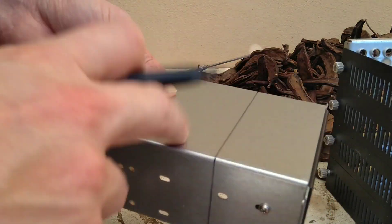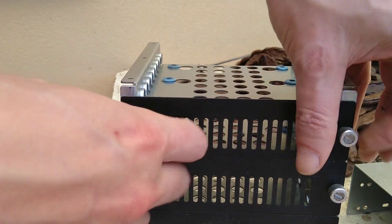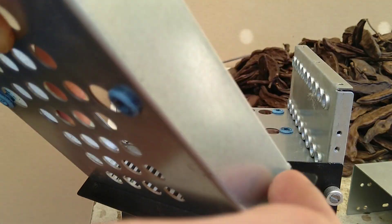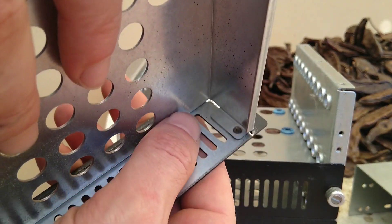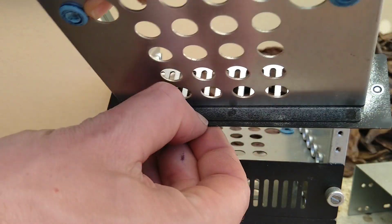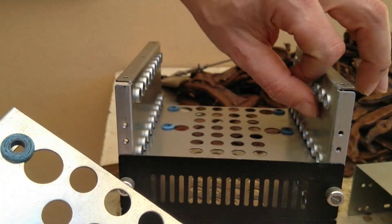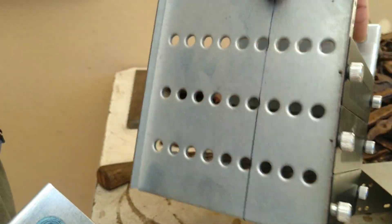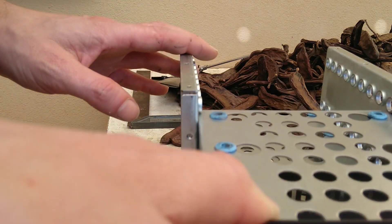And there we go. Okay, I've made a decision. I'm going to try and cut it like that, and then just there and there. You can see on the inside it's a bit easier to figure out what's been done — it's been folded over and this side's been folded out. I think I'll do that just for making it lighter, because currently it's very heavy, and it'll be heavy with a radiator in there, and these three-and-a-half-inch drive bays will never be used for that purpose. If you're not using an angle grinder, are you case modding hard enough?